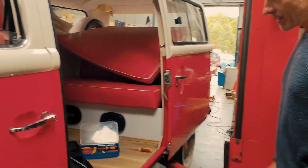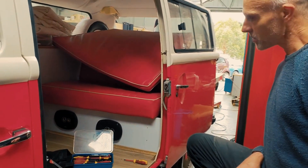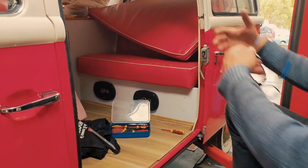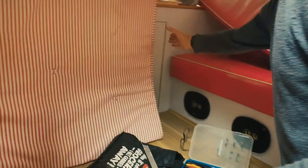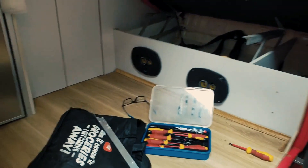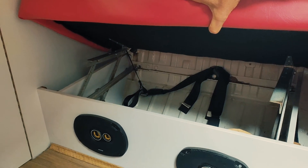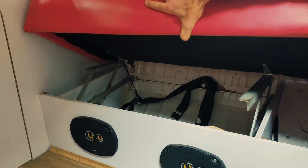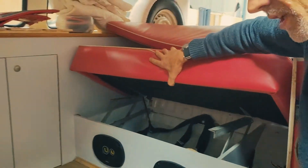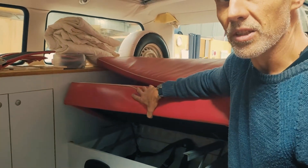So we've decided we'll have a rethink, and had a talk to the customer. He's prepared to lose — or gain — a little bit of floor height, to be precise. We've decided we're going to tear the guts out of this: the cabinetry is going to come out, the fridge is going to go up a bit higher, and the battery pack is going to sit under here. We had a few challenges with the BMS — it was tight — but now we can put our VCU in there, our BMS in there, slide an extra cell under there possibly, and I'm thinking about putting the air conditioning system in there as well.